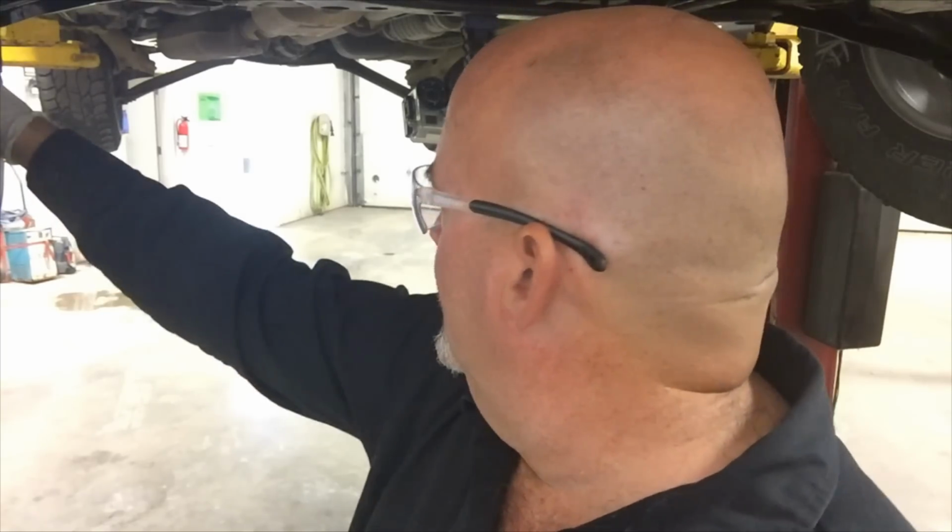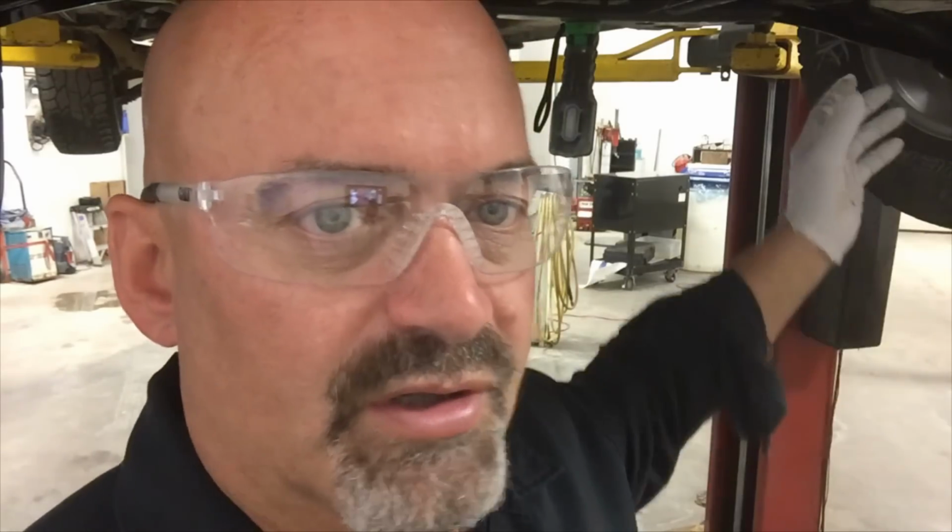Okay, we're gonna move on to a lube oil filter. Basically, I define a lube oil filter at my shop as being engine oil and filter change, and then checking vital fluids and lubing the chassis as necessary. This vehicle does not have any grease zerks on it, doesn't have any on the tie rod ends, or even the new ball joints, didn't come with them. But it is a four-wheel drive vehicle, so it's going to include checking the rear differential, transfer case, the final drive and transmission fluid, along with the coolant and power steering fluid, brake fluid, and whatnot.